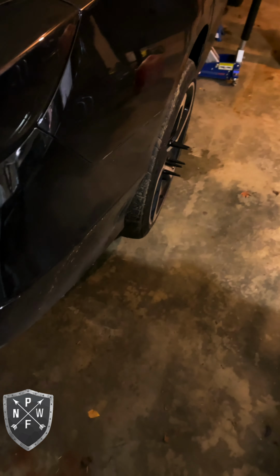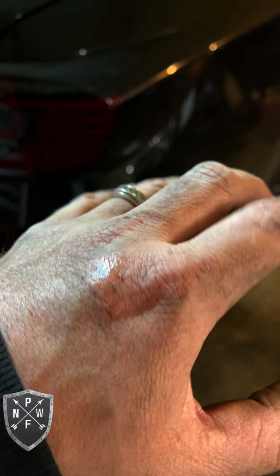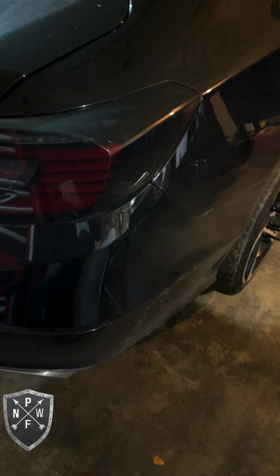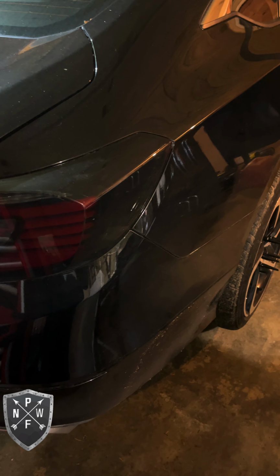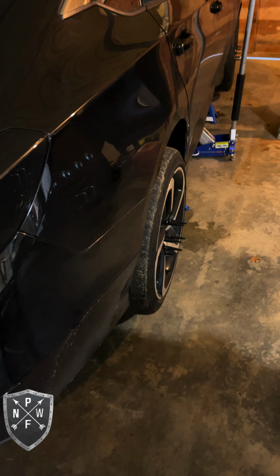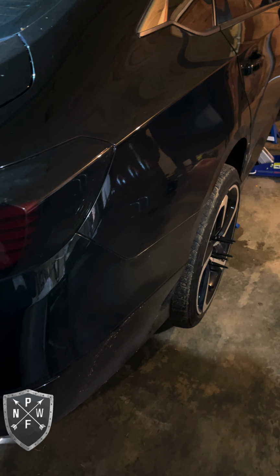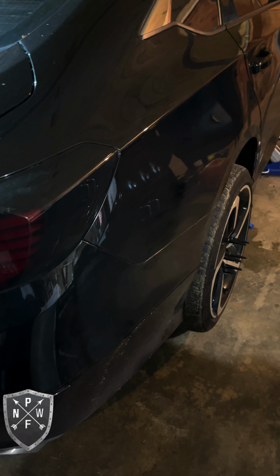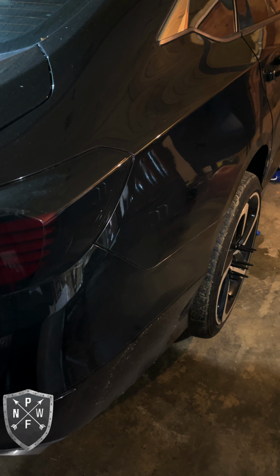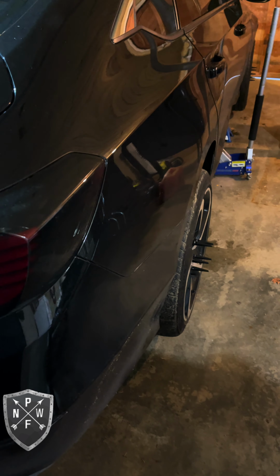When you're doing this, the driver's side inner bolt in and out for the camber arm is just a pain in the ass. As you can see, you'll skin your stuff up trying to get them in there. It was the hardest part. I think it'd be easier when you're doing your suspension at the same time, so you have a few more components out of your way. If you're taking everything apart, that would be the time to do it. I refused to remove that after I've already done my suspension, so it was fun.